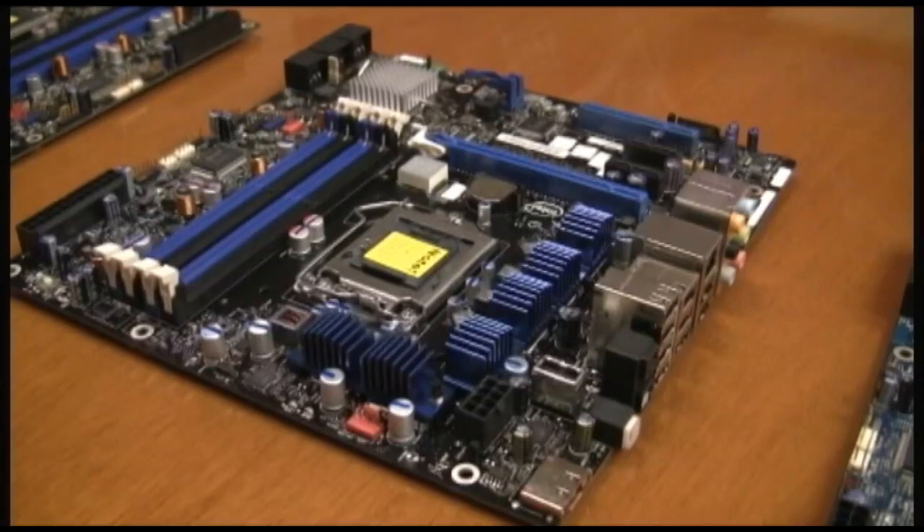Do you want to talk about the DP55SB? So this is the SB — this is the micro ATX Xtreme board. We didn't have one for X58 and there wasn't one for X48 either — this is the first Micro ATX board in the Xtreme Series in five or six years. The really cool feature about this one is the fact that it's a micro — you lose some expansion slots, but it still runs SLI, and it's great for your LAN party rigs, very portable. It still has all the same features: six-phase power, back-to-BIOS, LCD poster. You lose two PCIs and a x4, but no one uses those anyway. That works out very well.